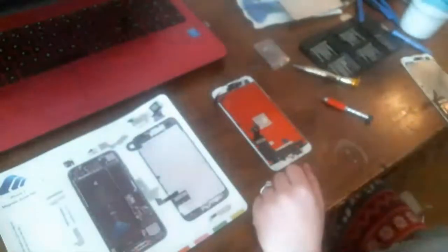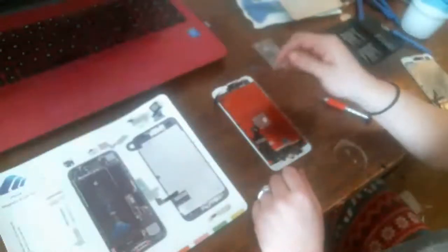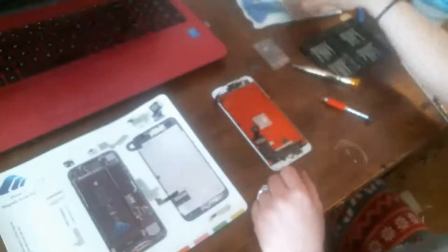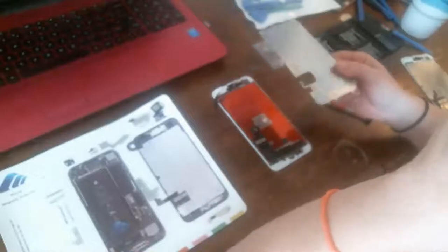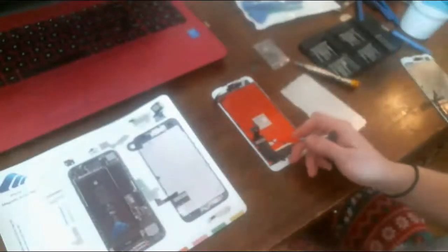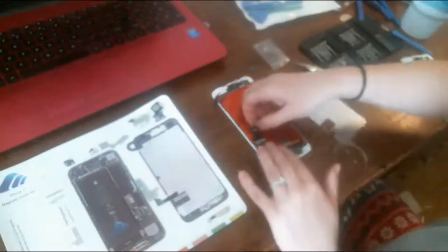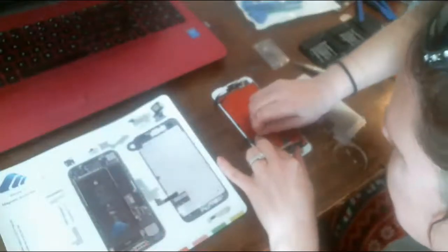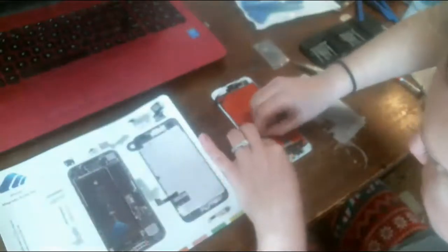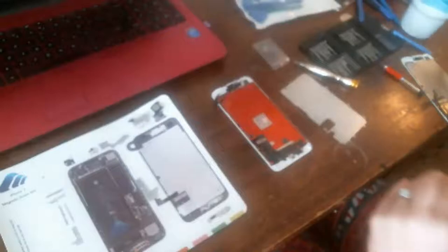Okay, so now what are we going to do here? I really don't want to move the flex cable. I'm going to have to lift it though to get the back frame on. I'm just sitting here pondering because this is the challenge when you put this back mid frame on. It never mattered on the other ones, but this one it does because the backlight's in this little box here. If that shorts out anywhere, then it messes up the whole screen and everything. But I talked about that before. I was trying to photograph it. And this cable's going to have to be loose. Oh, shit. Come on, don't rip the cable. Okay. I hate that tape. I hate that they apply all that tape.